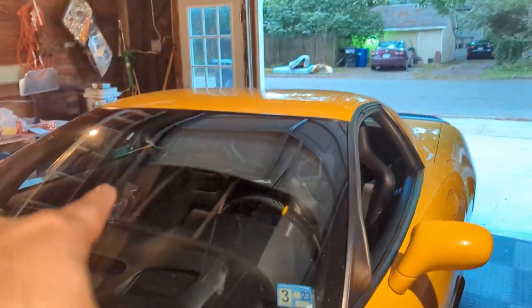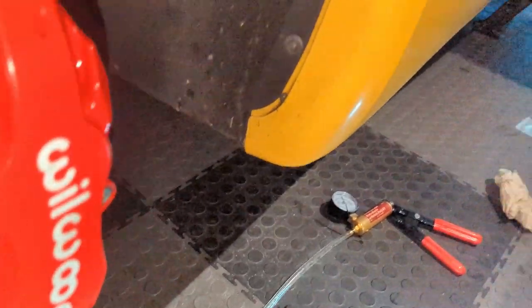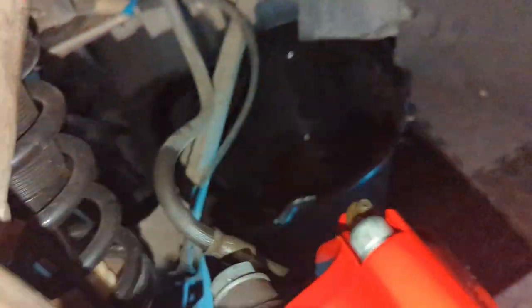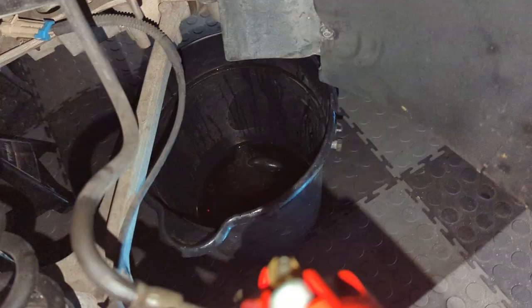On the last wheel here — I always start on the back, the furthest from the master cylinder, then driver rear, then passenger front, and finally the driver's side here. It's very simple to do, especially with this one-man vacuum tool. All I've got to do is crack the little bleeder valve right there on top — not the big brass one, but the little tiny one — about a quarter turn. I throw this little tool on there and draw a vacuum of 15, and I watch for the flow in this cup. When I stop seeing little tiny air bubbles, I know I'm good. I can close up the bleeder valve and we should be all set. After each wheel, check your master cylinder reservoir to make sure you have fluid in there.